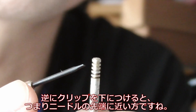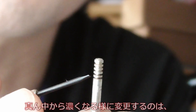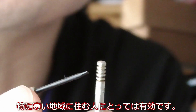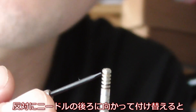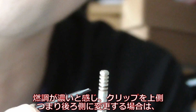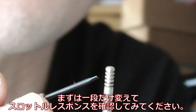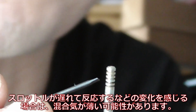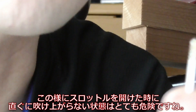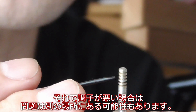If you change it to a higher slot, which is the back side of the needle, your fuel mixture is going to go leaner. If you go lower on these slots, which is closer to the needle tip, you're going richer on the mixture. Going from medium to rich is okay, especially for those living somewhere cold. If you move the clip to a higher slot, you're going to get a very slow throttle response, which could be dangerous. If you feel like you're running rich and move it to the higher slot, just move one slot above and double check the throttle response. If you're getting a delay on the throttle response, the mixture is too lean — you're opening up the throttle and not getting an immediate response, which is dangerous.